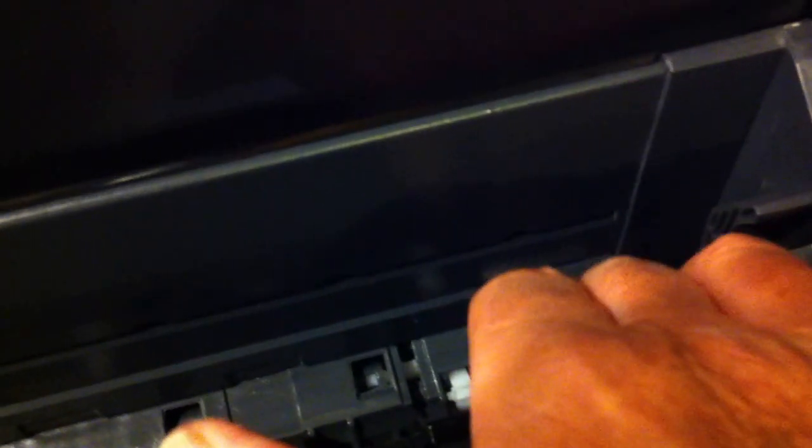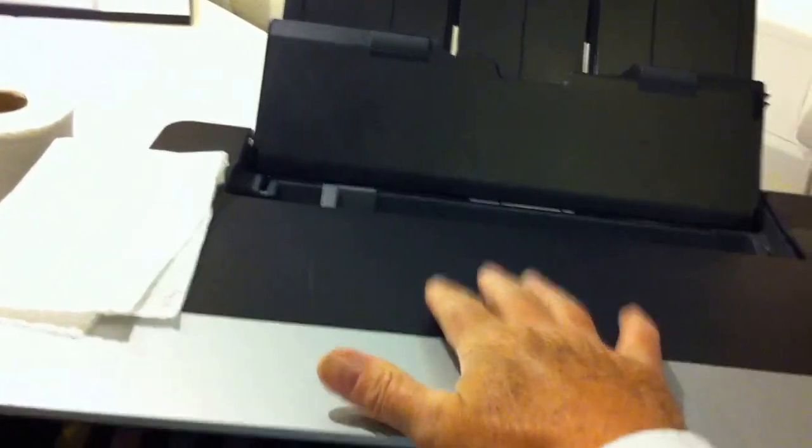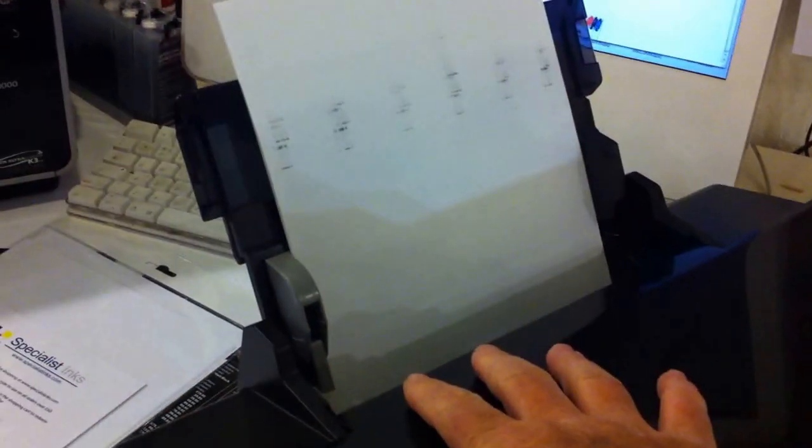There is one further little trick you can try: this little rubber band here — you can actually roughen it up. You can get the back of a knife and very carefully roughen that band up to get the friction back on that initial roller. Once you've got your paper feeds working on your A3 and A4 printers, it's not a bad idea to have a little preventative maintenance.